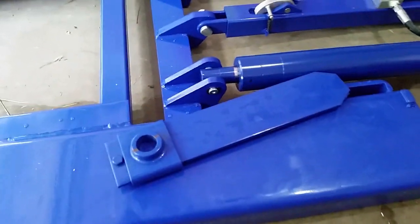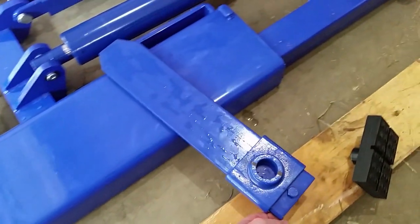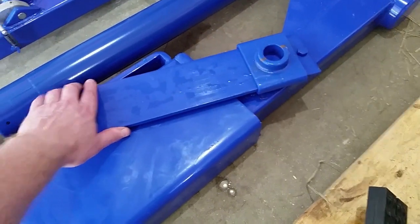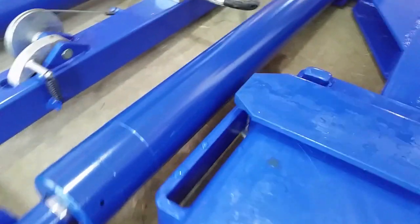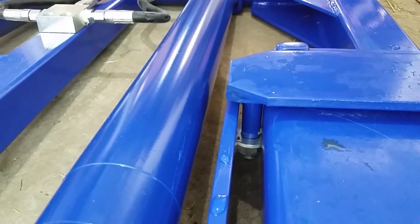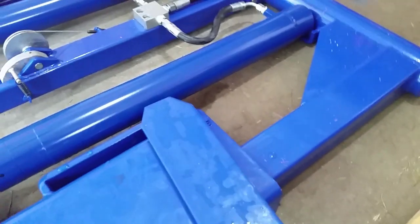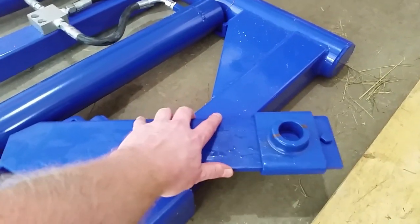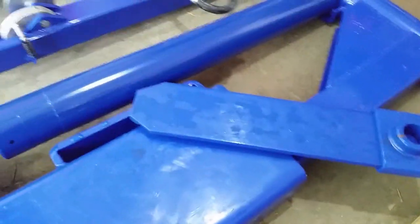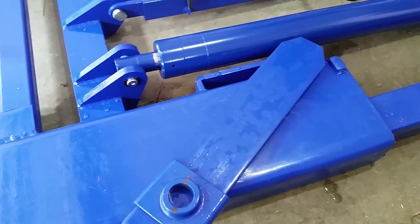Now, if we look at the extension arms, you can get a certain arc out of these, which moves around in a clean arc, but that's only if we're at the rear point of where the arm attaches. This is bolted on, and that's the pivot point for the arm. Now obviously, as you've seen elsewhere in this video, once this is at the front, any attempt to arc it forward will actually reduce the overall length, and you see the pivot point has to start to move back. So we don't get a true arc at this point. So it's difficult to give you a true measurement for all points on the arc without some advanced mathematics.